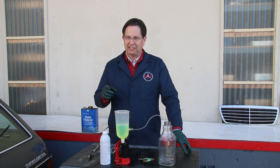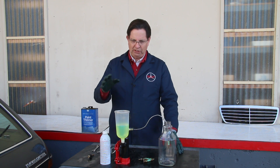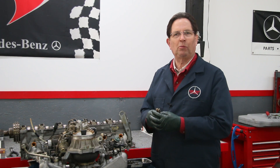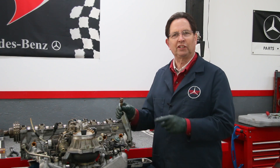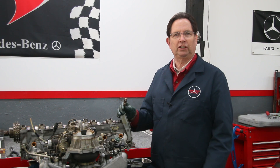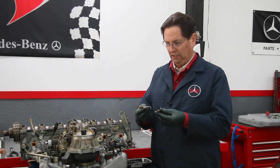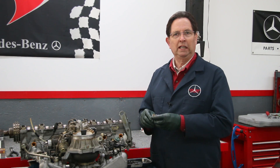If you're interested in learning more, we have a complete video on the cleaning process and how to set everything up using our pressure tester — follow the link below. The procedures for testing and cleaning these CIS injectors apply to almost all Mercedes gas engines from about 1976 up to 1993 — that's a lot of V8s, four-cylinders, and six-cylinders. The difference between this late-model injector and an early-model is only in the thread size, which means a different fitting when you go about testing.